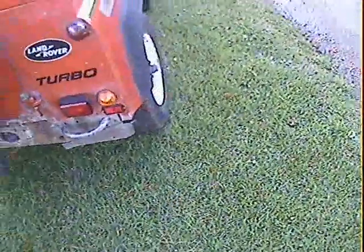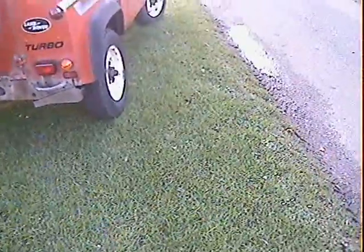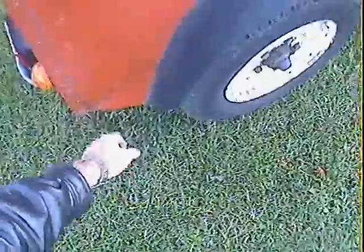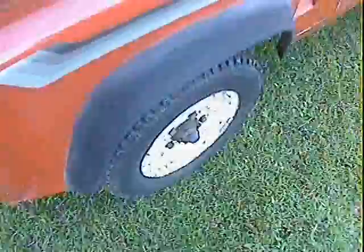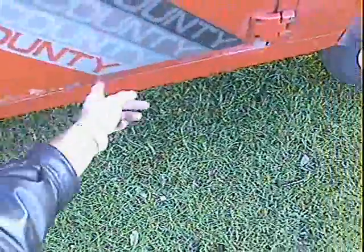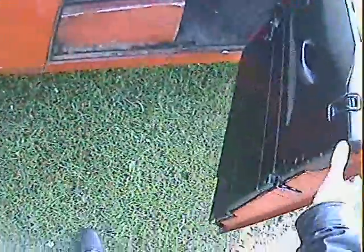There's a rear-mounted spare wheel on this one. Looking down the offside it's pretty straight. There's probably a slight dent in the offside rear wing panel and a crack in the offside rear rubber arch. Once again there's electrolytic reaction on the base of the driver's door. This is an original car really, and the driver's door frame at the base is going a bit rusty.